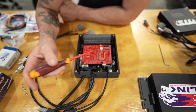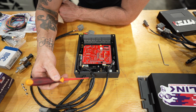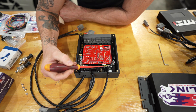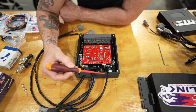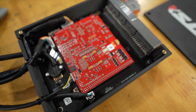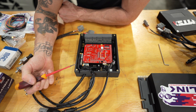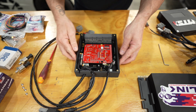Here at Motorsport Tuning Solutions when we do our installs, we sit it all in really nicely with no tension on the plug itself, and then put cable ties on either side of the cables going through the casing, just so they can't be pulled back. So there's no tension. And then you've got your seven bar MAP sensor which comes through here.